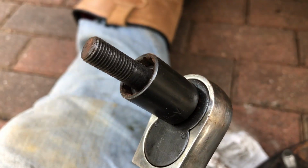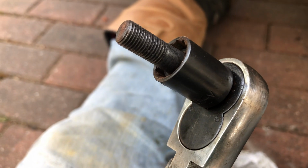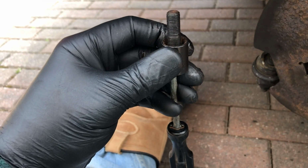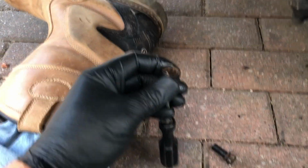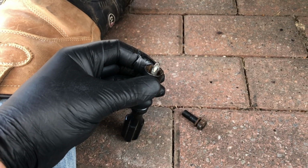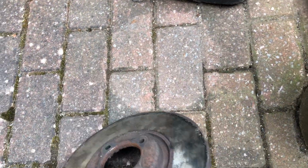And before I proceed, here's an Arry The Stag top tip. If you have a bolt, as we have here, stuck in the socket, then a good idea is to take the socket off, put a screwdriver through and tap it on the ground. So I've removed the socket from the ratchet, and you see the screwdriver there, and simply all you do is tap it on the ground and, there you go, it releases. Simple but works, saves loads of grief. Arry The Stag.